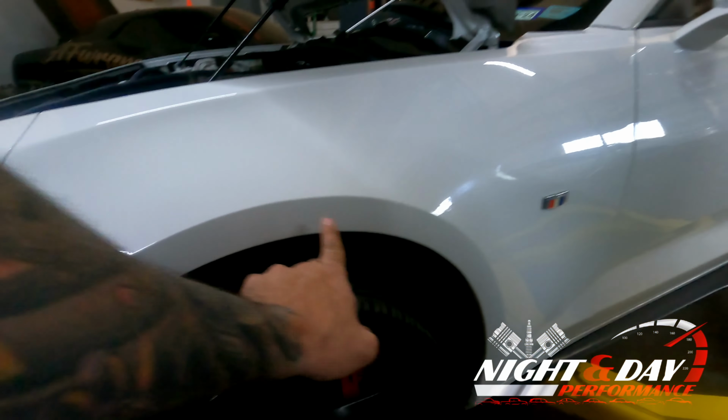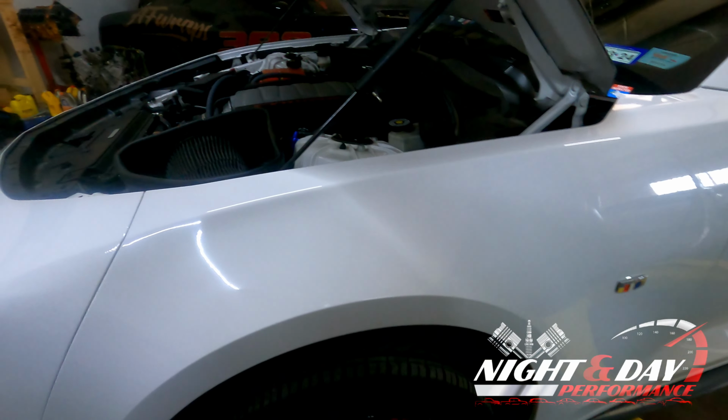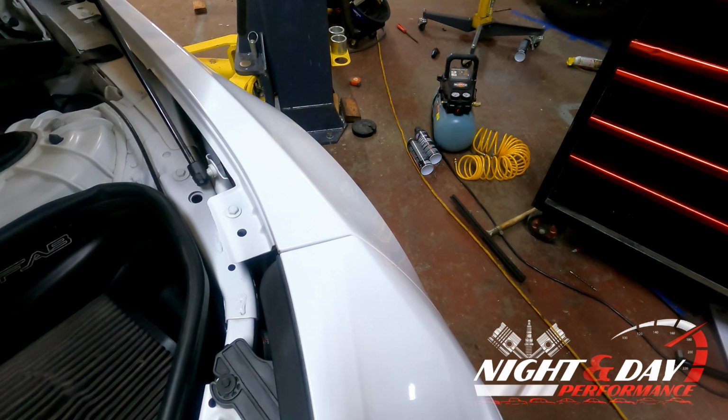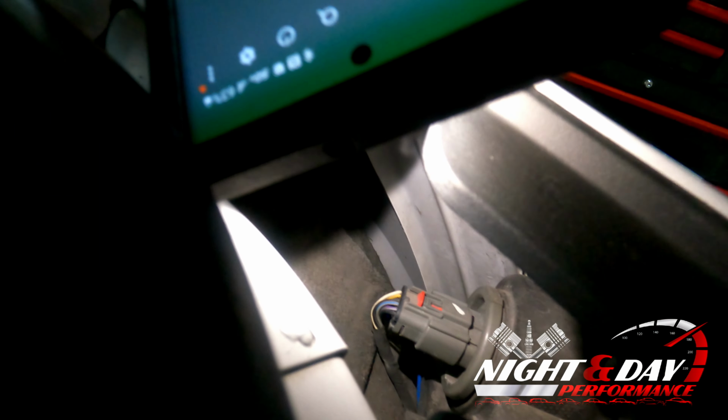The wheel liners that are inside, you can pull them back or remove them. We're doing underglow, so I'm removing these front two. And then we're going to have to go right down here in the fender, and there are going to be some screws. There are 3 screws down there that you're going to have to remove inside this tight little space. So I'll shine some light here so that hopefully you can see.